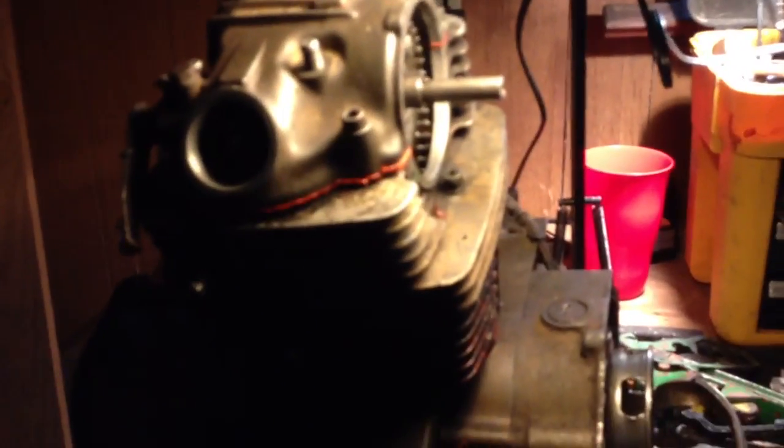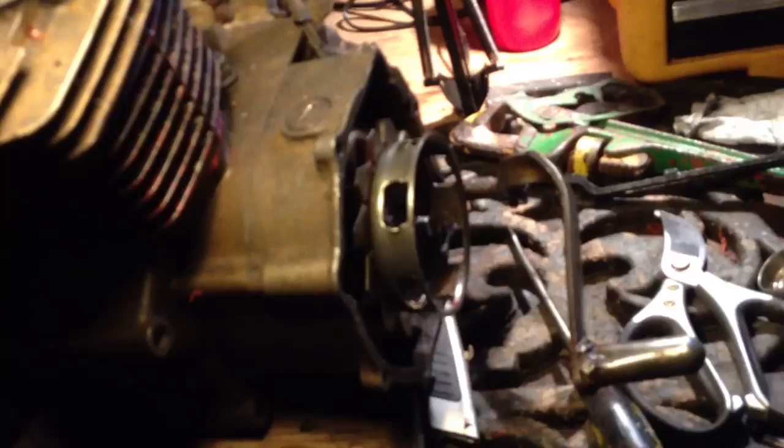This must be an oversized piston, so that means I need to get it bored out. I'm just gonna order a new piston — one of these kinds that sticks up off the top with a valve cut instead of just a flat top, to get a little more compression. But I forgot to put one of the circlips in on the piston for the wrist pin. I forgot one of the circlips. I got this far and just realized it — luckily I didn't get my four bolts in yet, but I had the head put together, timing lined up, and everything siliconed. I was pretty much done finishing up when I realized the circlip wasn't in there.